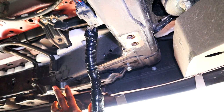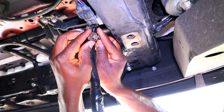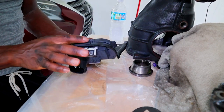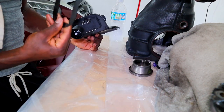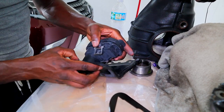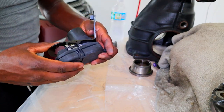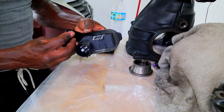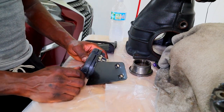Just like that I put this piece back and now I just have to install the cable tie — it's going to go somewhere right here. The next thing you have to do is remove the wire harness plug from this bracket. I believe what you do is just press these and push it out — yep, just like that. And for this one it's like this, just like that. As you can see it's all firm in there.